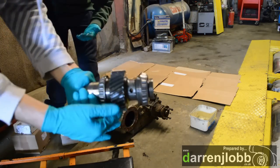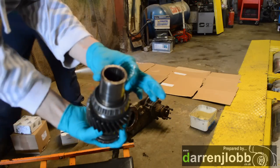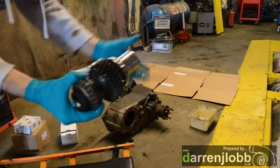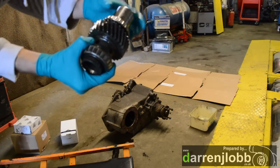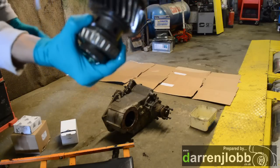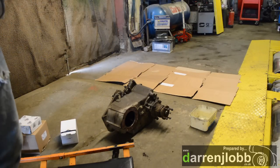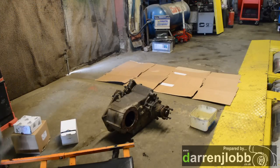That's a standard Land Rover input gear, and that there is the piece of steel that's been machined for ZF output on the box. We're going to be changing this gear for one of the ones in those boxes, so this is going to need redoing. Luckily that bit you can just drop in afterwards, so that can go off and get posted off now. Meanwhile we can rebuild the rest of the transfer box and then just slot this back in afterwards.